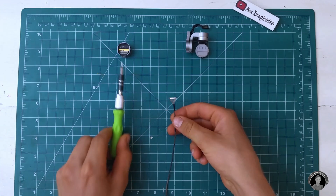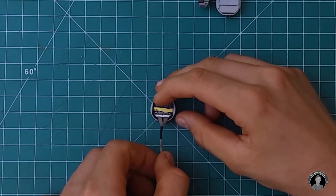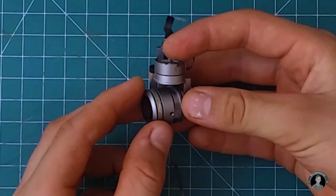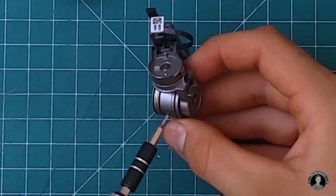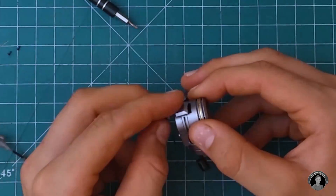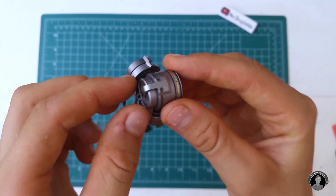With the new cable out, keep in mind that the even or straight looking end goes to the camera sensor and the lopsided end connects back to the circuit board. Connecting the brand new cable up to the camera, all it takes is a gentle push for it to clip in. Then you're going to want to slide the camera sensor back onto its mount in the gimbal and fasten the two screws on either side. Then attach one of the few plastic panels to keep the cable straight and pointing out the back, being very careful not to pinch any of the strands coming from the cable.